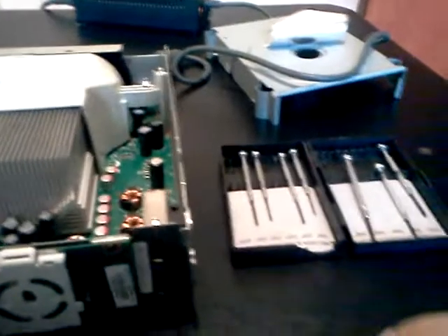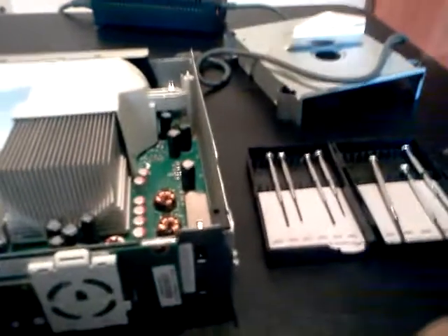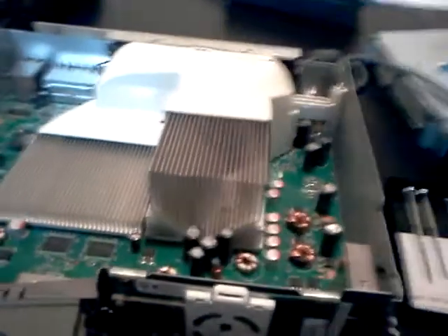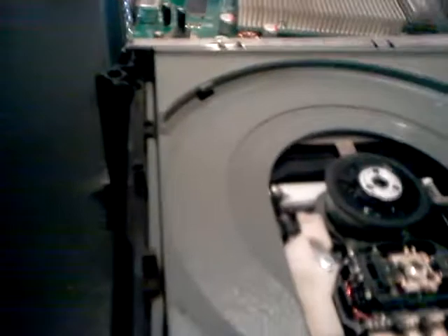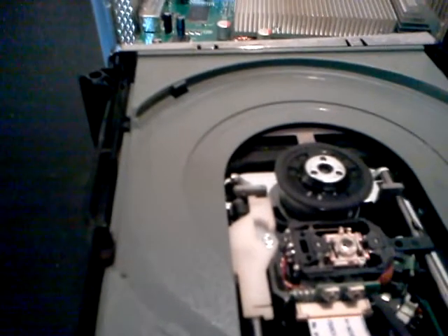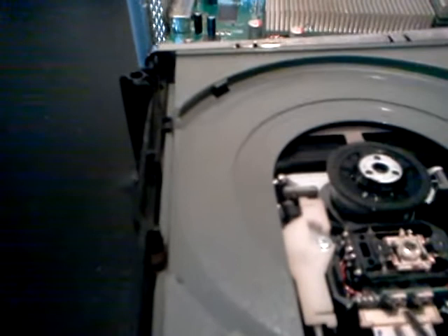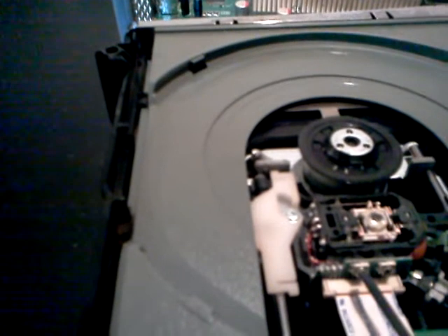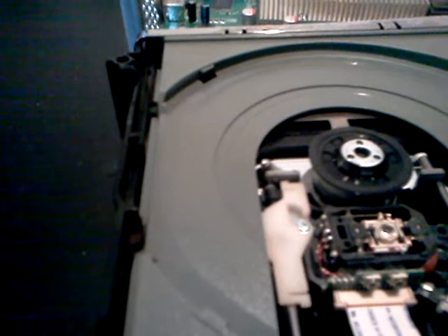Once you get your reading, when I saw it was five kilo-ohms, what I did is get a little screwdriver like this one — this little set right here. This is a flathead. I think I used the flathead. What you're going to do is turn it counterclockwise. You're going to stick it in. Don't touch the one on the right — only do the one on the left, because that's for your CDs and we're trying to do this for the game. So you're just sticking in this little middle part right here and you turn it counterclockwise, that would be to the left.